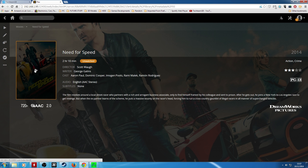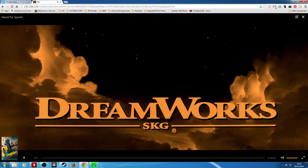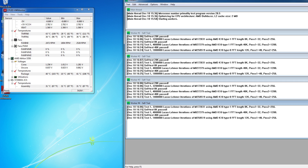Since this technically still is a CPU review, I can't finish without benchmarking it. I ran Prime95 for a few hours and was seriously surprised with the results. My room, which is normally about 30 degrees, was often warmer than or the same temperature as the CPU, meaning that this power-efficient chip — which has a TDP of 25 watts — can keep itself perfectly cool under 100% load of small FFTs, with four cores all running at 100% and not maxing over 40 degrees. That is fantastic, and for anyone who wants to run this as a web server, keeping it even in a cupboard, it will still not get too hot even running plenty of MySQL queries.